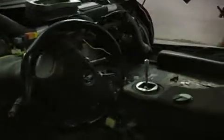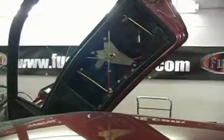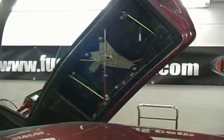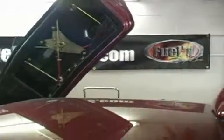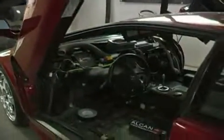This way, if you forget any wires or forget something, you don't have to go back in and reupholster panels at that point. So we call it mock-up at this stage, and we'll start seeing panels going back on the car just in their raw state. And then once the whole car is into that, as progress goes here, we'll start taking panels back out, wrapping them in the leather, and then they'll go back in for their final fit, and then they'll stay in at that point. That way you're not handling the leather as much, and there's less risk of damaging stuff in the build process.